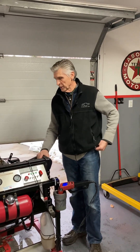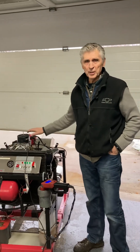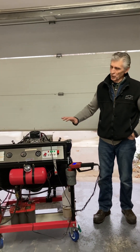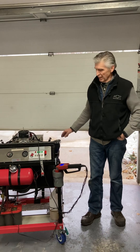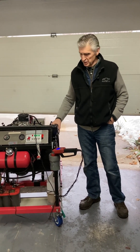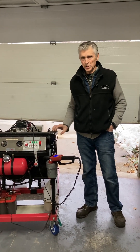Watch for the next video of this engine — it will be on the dyno. We did go to a roller cam, not because we're trying to make a ton of power. What we really want is a long and happy life, and that's one way I can be sure of getting it. After what we went through with this one, I just didn't have the heart to put another flat tappet cam in, even though it probably would have been fine. I've probably put a couple dozen of them in this century without issues — it's usually infant mortality, happening right after startup. This one ran for a year, and I'm giving you a pretty good indication of some possible causes.